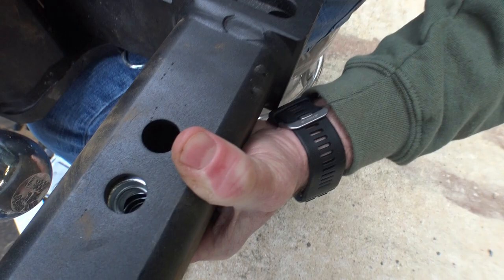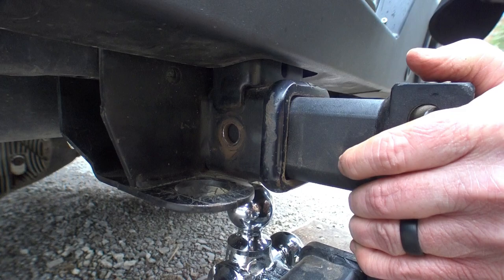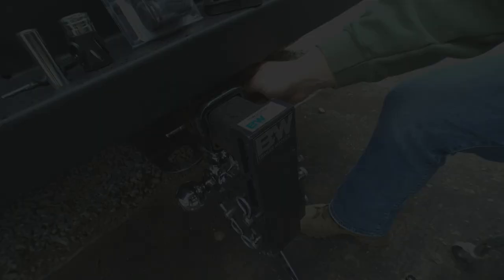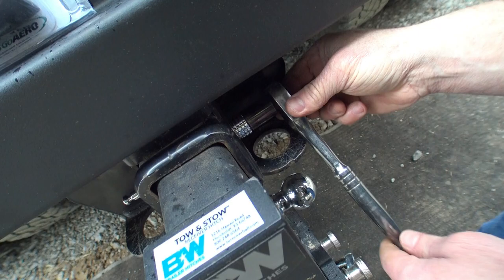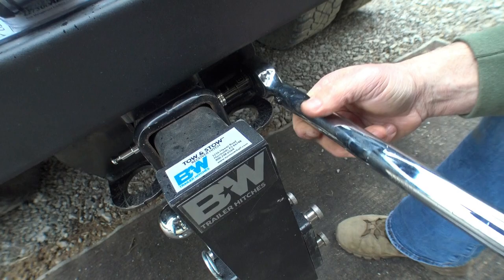Take it into the first hole, line that spring up, insert it into the receiver, and go in right to where that hole stops. Then take this piece here and just insert it right in there, start threading it in, take it into where it hits the lock washer. Then you can take a 16-millimeter and get it in there, tighten it up nice and snug. According to the instructions, take your torque wrench and torque it to 35 foot-pounds — just like that — and you're good to go.